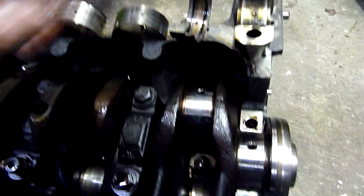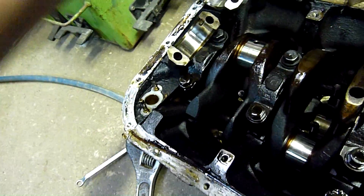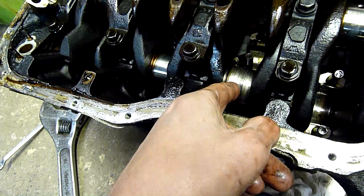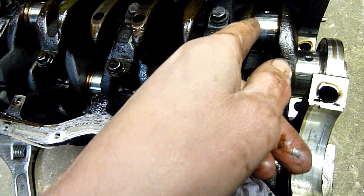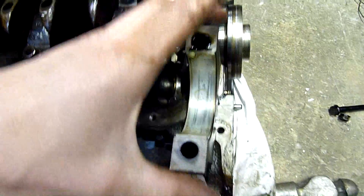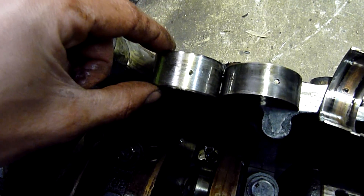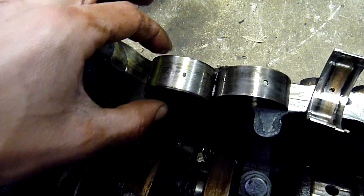Number four wasn't far off because you've got the oil pump at the front of the engine. Oil pickup, oil discharge on the other side, coming through the crank. The failed bearing there was just dumping oil pressure by the end of it, leaving number four suffering. The rearmost main bearings are also suffering a bit but not quite as bad. Complete catastrophic failure - look how smooshed out that bearing shell is, it's almost a quarter of an inch wider than it's supposed to be.